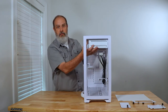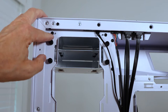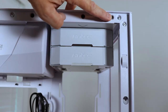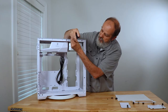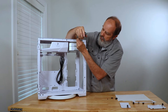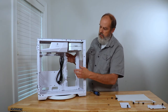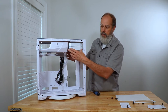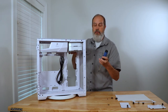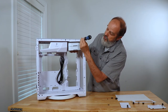The front panel does remove. To get to it you first need to remove some hardware. The two hard drive bays have two thumbscrews, and the top bracket has two more screws up top. Depending on your cooling options, you'll need to remove one or both hard drive bays. For three 120mm fans, remove the bottom one. For a 360mm radiator, remove both — meaning you won't have the option of a 3.5-inch drive with that cooling choice.